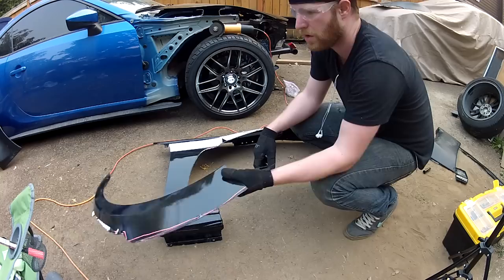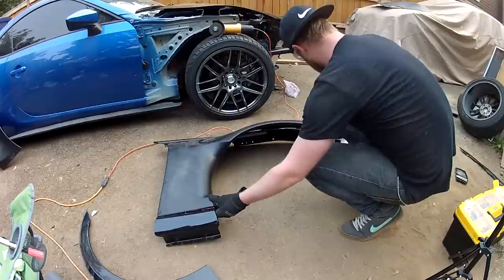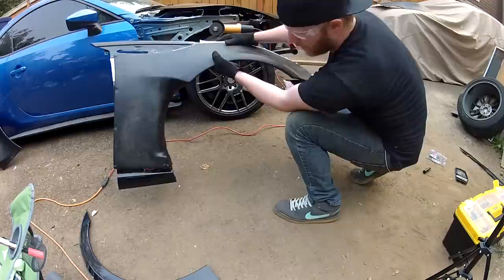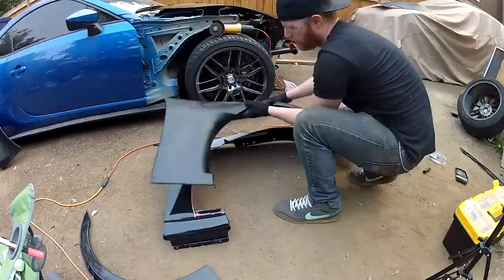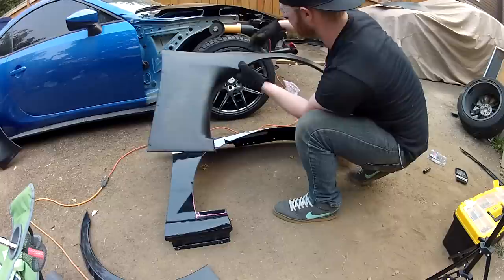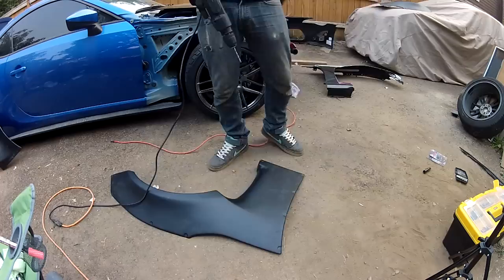It's always a good day when you get to cut up your brand new $300 car parts. I'm going to grab my cutting blade and cut out everything marked in pink so the overflare fits. Looks like we're in business — this is roughly the finished product we'll end up with. Next I'm going to drill holes through the overflare where the dimples are, then line it up correctly on the fender and go through the holes with a Sharpie to put dots on the fender where I want to drill my holes.